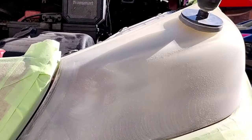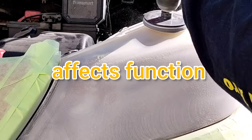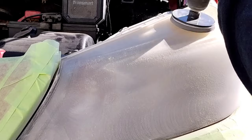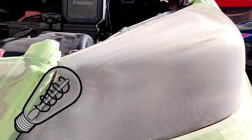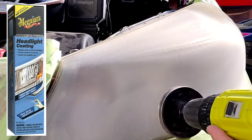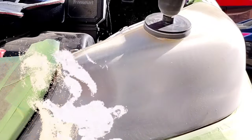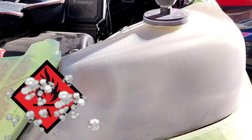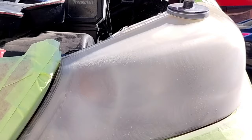I don't advise heat lamps because it affects the way certain clear coats dry, function, and cure. Sometimes if you cure it too fast, it's not going to achieve the correct clarity — which I have learned in the past. I've tried heat guns, UV lights, expensive equipment. I have a $250 angled heat lamp. But I finally realized that this Meguiar's product is more of an evaporating drying compound, kind of like superglue — which is why it stinks so bad. It dries better with air exchange.